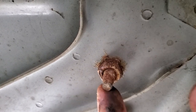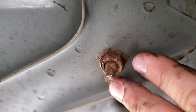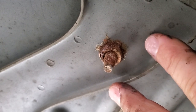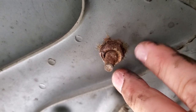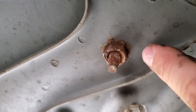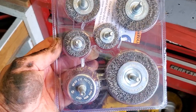Here is the bolt. You can definitely tell it's suffering from a pretty nasty case of rust — it's completely surrounding the nut. They're probably fused together and it's starting to eat its way onto this little cross support piece. I'm gonna clean this up and weld another nut to it and hopefully back it out. If that doesn't work, I'll go from the top and try to ram it out with my air hammer, then re-thread or weld a new nut.